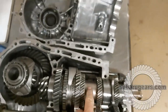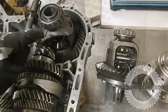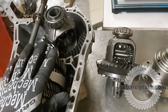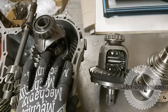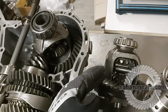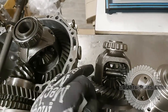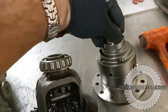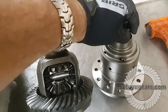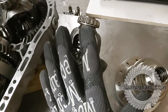The TY758 has no provision here for a VSS speedo drive gear — it's left blank and blanked off with no gear like the earlier gear sets. The standard Subaru differential is quite open in its iron centre. In an all-wheel drive configuration the torque is split between a front and rear differential, so the torque is halved. In our application all of the torque goes through the front differential — which is now the rear differential. With very high powered turbo cars, six cylinder cars, and heavy cars such as Vanagons loaded as campers towing trailers, this iron centre is prone to fatigue and cracking. That's why we recommend Subaru's limited slip differential — it's made out of billet and is a completely different design with all the extra material, not being open.